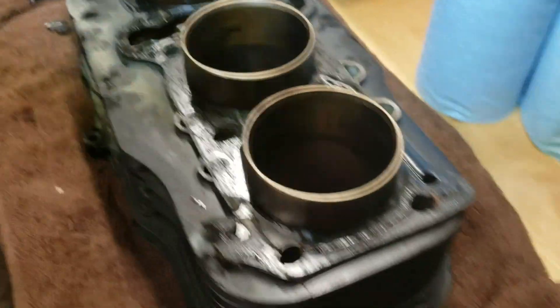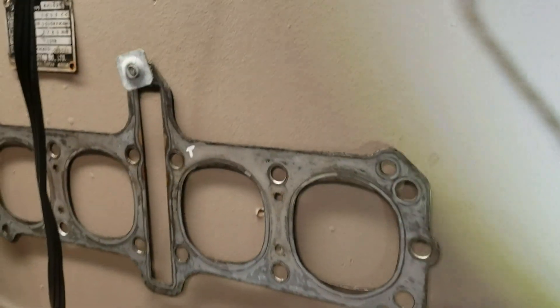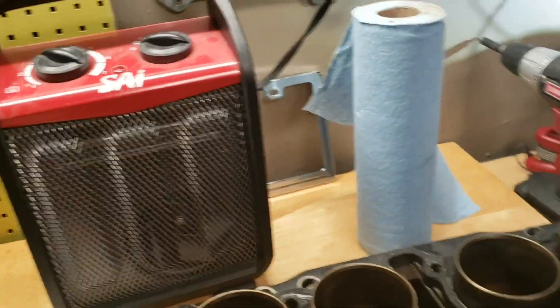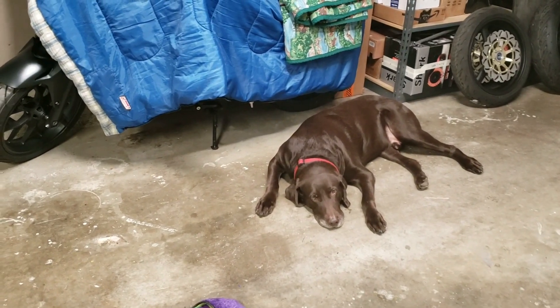The gasket kind of broke off — that piece over there, and that piece sitting there — and that's the head gasket right there. I'm glad I took this apart because I can replace the head gasket; it's separating a little bit. I've got the gaskets for it. Other than the cam situation which was disappointing, the motor is great and I'm stoked. Anyway, watch my videos, please hit subscribe, and don't forget to hit the little notification bell for upcoming videos — thanks for watching.